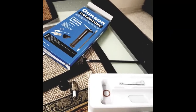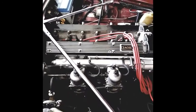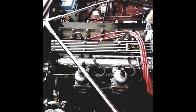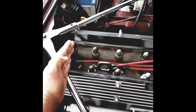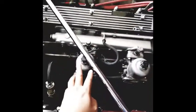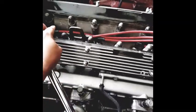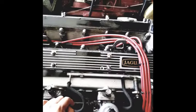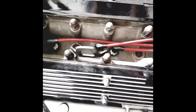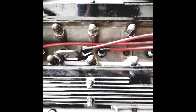Now I have my engine warmed up. You have to ensure your engine is warmed up. This is a six-cylinder car, so plug number one is over here and plug number six is over here. We have two carburetors — the first front carburetor is supplying three cylinders, and then the other three cylinders are four, five, and six.